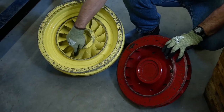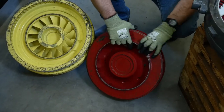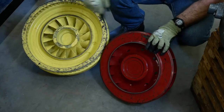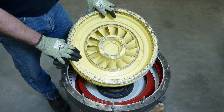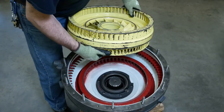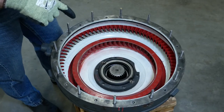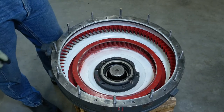That third set of blades redirects the oil back into the center of the impeller again. The oil in the last stage of the turbine comes out this area and brings it right back into the center of the impeller, where it's being turned by the engine. The process then begins once again. This turbine is one physical wheel, but it has three separate sets of blades — one set here, a second set here, and a third set in here.